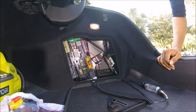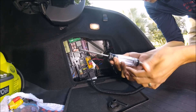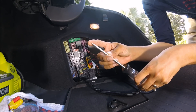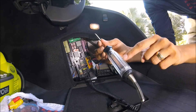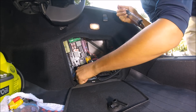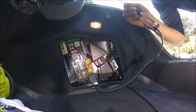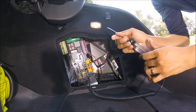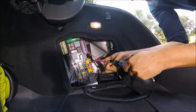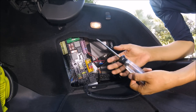At the back of the vehicle I have a simple part from an auto parts store that's really easy to use and not used enough. It has a sharp metal point that feels for positive, and inside there's a light bulb. You plug the negative part into a grounding point — in this situation it's the grounding bolt. We're going to test it on the hard wire with the vehicle in reverse, and sure enough it lights up. That's working perfectly.